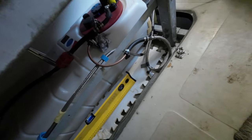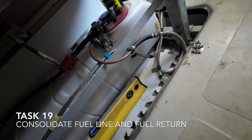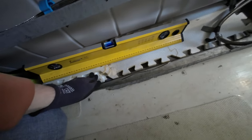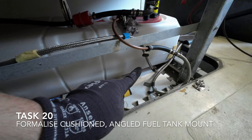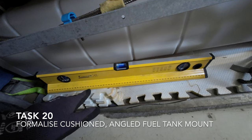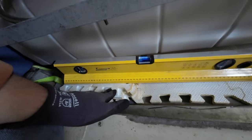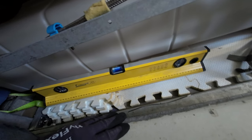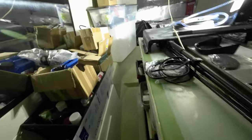I'm also going to replace all this — you can see down here it's all very temporary. This was a bit of a bodge we had to do with the fuel line for the London trip. All this is going to be re-hosed — it looks like a bigger job than it really is. It's just a case of replacing a few lines and mounting them on proper clips. All this foam down here is keeping the fuel tank at an angle so all the fuel travels down to where the collection pipe is. That needs to be formalised — the principle works, so I'm going to fit in a slight slope at that angle with foam padding on top for the fuel tank to sit on, then strapped and locked down at both ends.